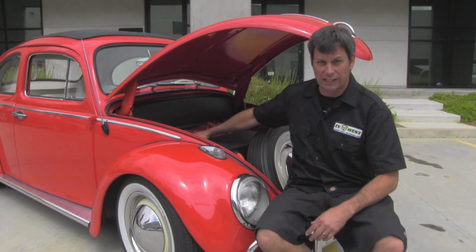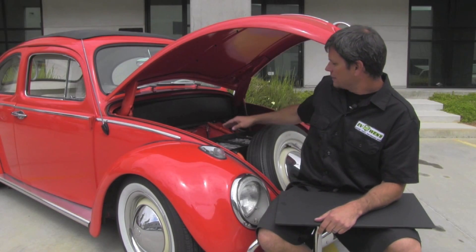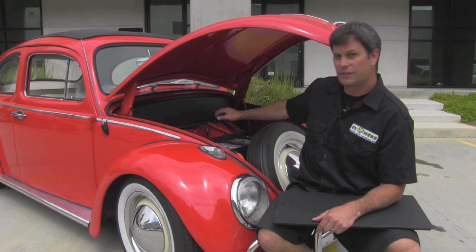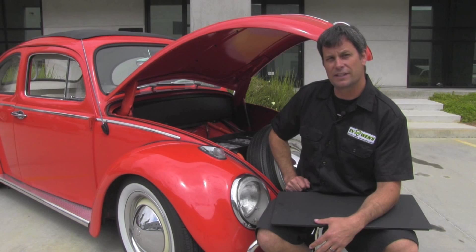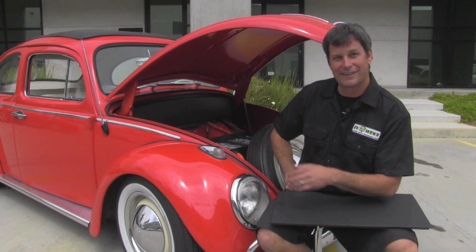And we have our little marine board lid. I'm going to take this off for you so you can take a look. We have our box in here. We have our fuse inside the battery box. We have our steel hold downs and our 6061 aluminum battery straps. Makes for a really clean, really efficient setup in the front of this car. I know some of you guys in the last video were asking to really see the batteries — there they are.